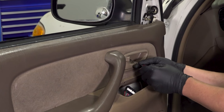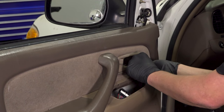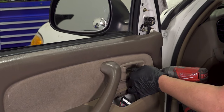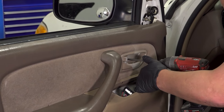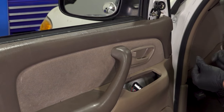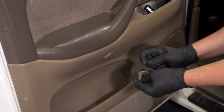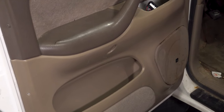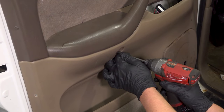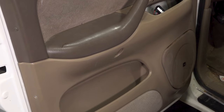There's a little cap in this door — using a little screwdriver, pick up on that cap, and there's a Phillips head hiding behind it; take that out. Using a little screwdriver, pop the cap out on the side of the door, and behind there there's going to be a little Phillips head screw. Go ahead and remove that.